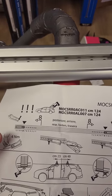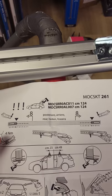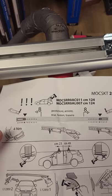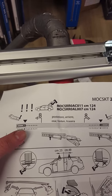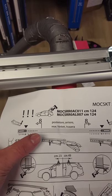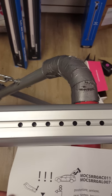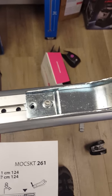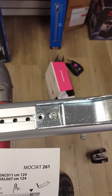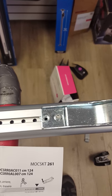Your first step is to figure out where the leg goes on the bar. What you can find in your instructions — this one is for a Ford Focus — it wants you to be eight holes from the center of the bar. Those are equivalent to these here, so that'll be one through eight. You may notice that I have it in the wrong spot here; that is because these are some demo bars and we're just going to be assembling this one to give you an idea of where everything goes.